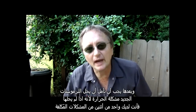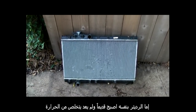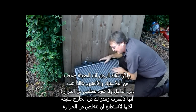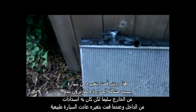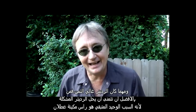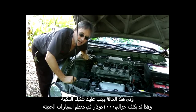You better hope a new thermostat fixes your overheating problem, because if it doesn't, you have one of two rather expensive problems. Either the radiator itself is just so old it can't dissipate heat anymore, or the head gasket of the engine is starting to blow. These modern radiators are made of plastic and aluminum — they often corrode inside and don't dissipate heat, they don't leak and look perfectly fine, but they just can't get rid of the heat. I just replaced a radiator in a car because it was overheating — it looked perfectly fine but was corroded inside, and once I replaced it the car ran normal. As expensive as some radiators may be, you better hope that fixes it, because the only other thing can be a bad head gasket, and that requires tearing the engine apart — which can cost well over a thousand dollars on most modern cars.